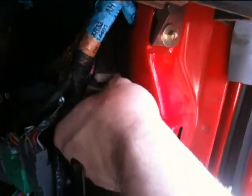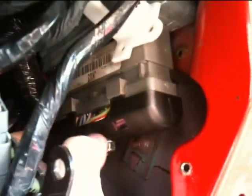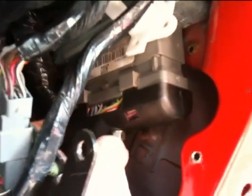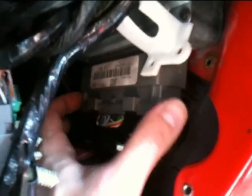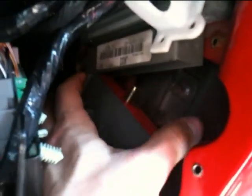This will make it easier to unscrew the main bolt holding the ECU. You can release it from this plastic harness. Now you could tilt it towards you. So now we can unscrew this. I got my screwdriver there with the bit on. It is unbolted, so now I just have to pull it out. I just grab the ECU and wiggle it out.